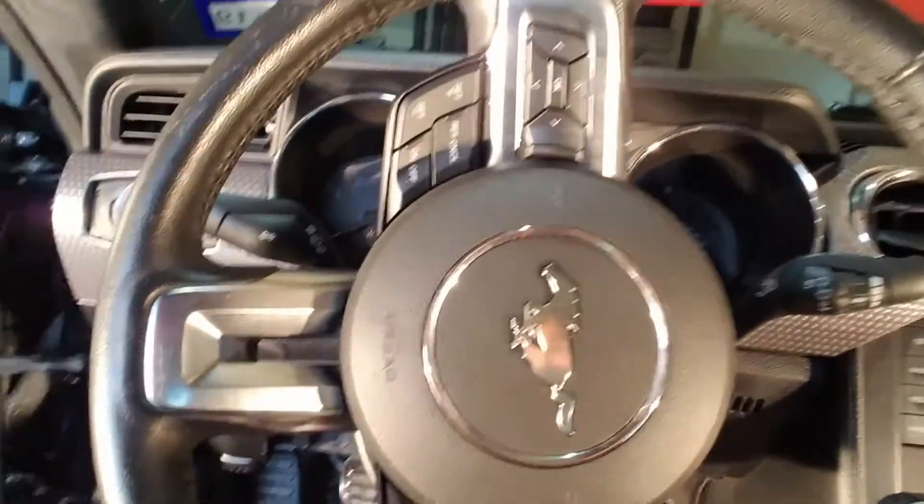We already showed how I cleaned out the interior of the car, took out all the seats and carpeting, and wiped everything down. Now it's time to start working on the dashboard, because the dashboard has airbags in it. Since we're going to have a roll cage in here, I can't afford to have any part of it hit by an airbag. If an airbag deploys and hits a metal bar, it could bend or break — that would be bad news — so I've got to remove all the airbags from the dash.